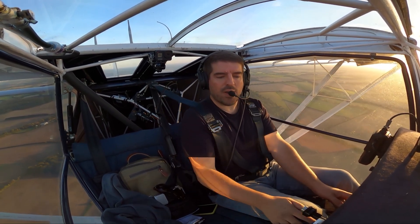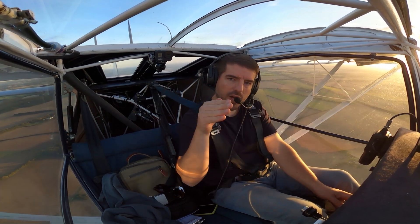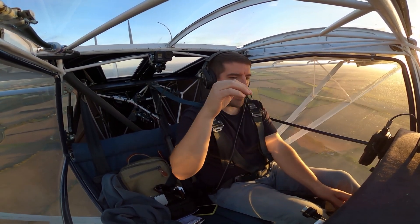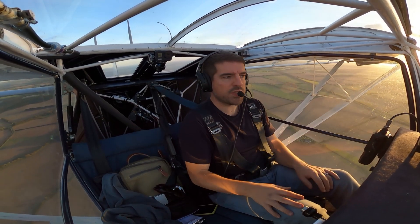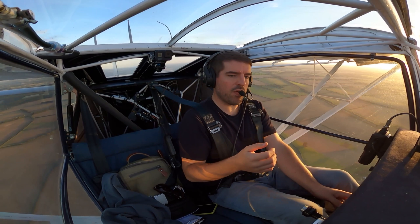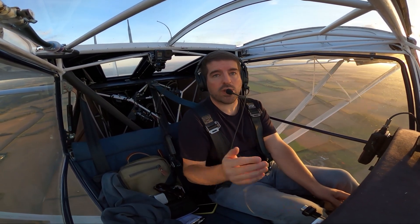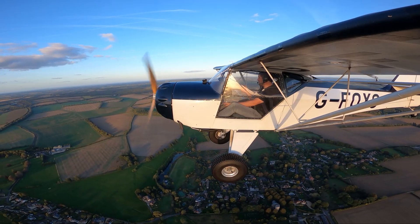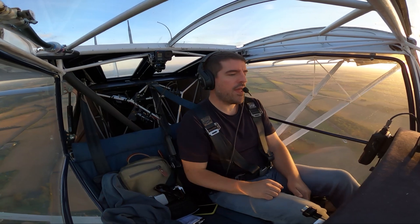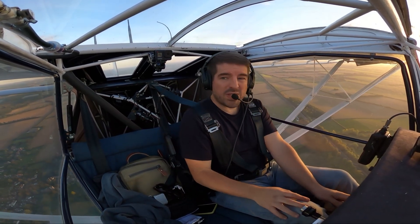The float valves were a little worn, but I don't think they were letting fuel through early. So the main problem from the last video was the leaky primer, which I removed. I had to remove it anyway because it was leaking at the firewall where it goes through to the carbs. Once that was done, it seemed to make a world of difference — it wasn't running rough anymore, but it wasn't as good as it could be. So that's when I ordered the carb rebuild kits from Aircraft Spruce or LAS in the UK. I'll link to both below.